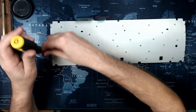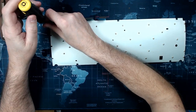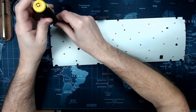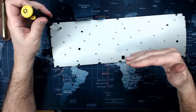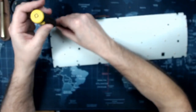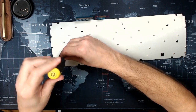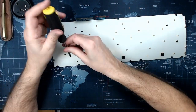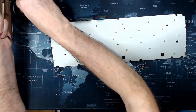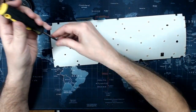So, that's a challenge. We're making a new PCB for sure, but I just have to try some ideas. Maybe each row going across tilts as it goes, and then you put three screws in each row so each row is not flopping around, but solidly held to this plate. That's what I'm envisioning. But then you look at the cost of making it. I guess the cost is per square inch, so if I do one solid PCB this dimension or four or five rows that add up to the same dimension, I wonder if it's the same price. I guess it should be.